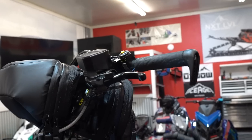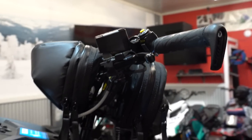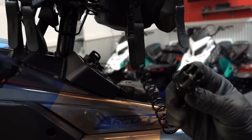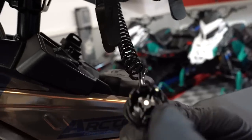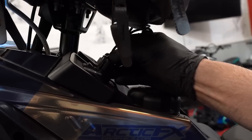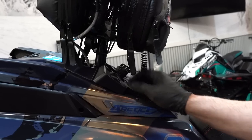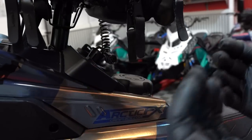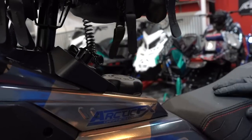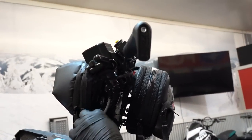Moving back to the controls — these are out in the open and we see them: checking brake levers and grips for condition. Underneath the controls, a lot of guys use the Polaris tether and I am as well. Make sure the clips in and around the tether are intact — carry a spare tether because if either breaks off, the way it seats onto there might not work as well. Your controls — at times the backside of your bright light switch and hand warmer switch can wiggle loose. Pulling the gas cap off and exposing the back of this panel is a great way to see if those connectors are intact.